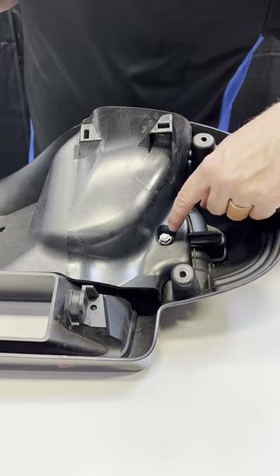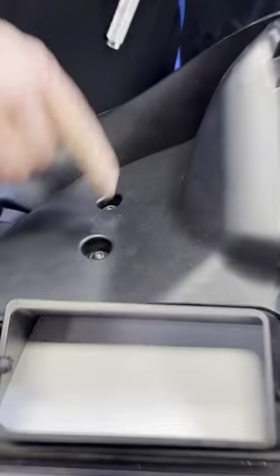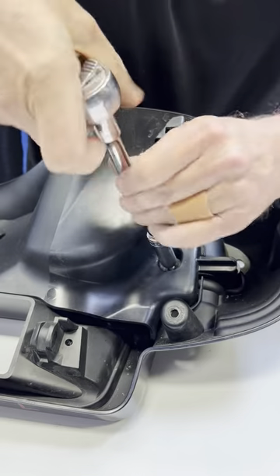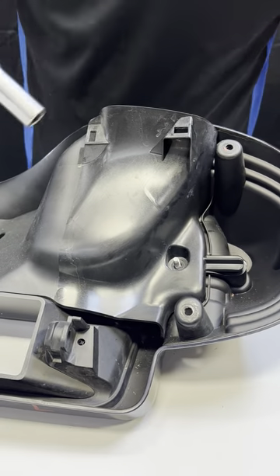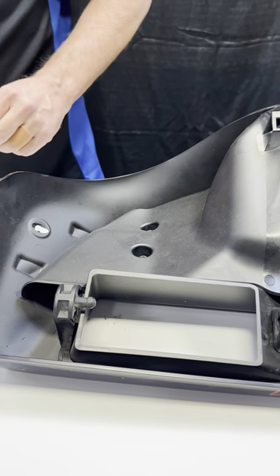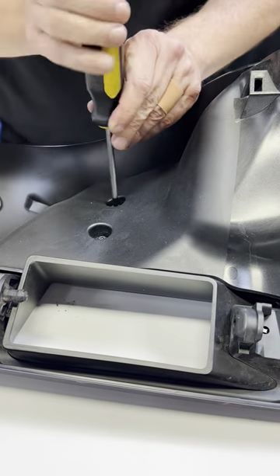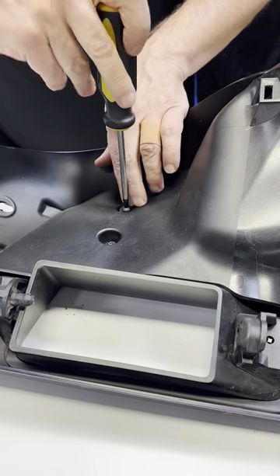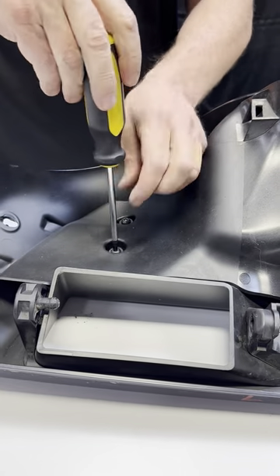There's another 7/16ths nut here and T27 hex bolts here. If you've got a water-cooled bike — and most of you probably do — you're going to have your radiator lines coming through here and down here. Of course, when you're all done, those don't interfere with the new Ultra Cool oil cooler, which is really nice. But you've got to take these pieces of the lower fairing off. Our installation guide will have step-by-step color photos of everything shown here as well.